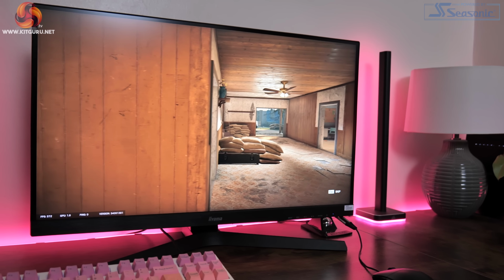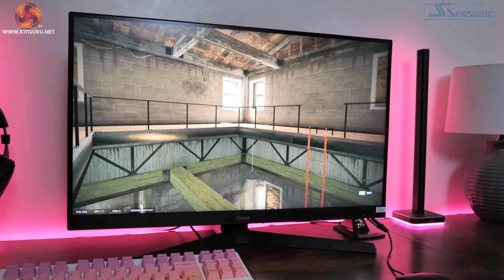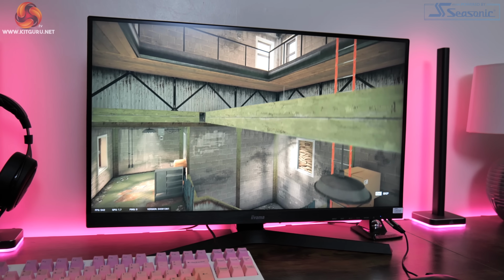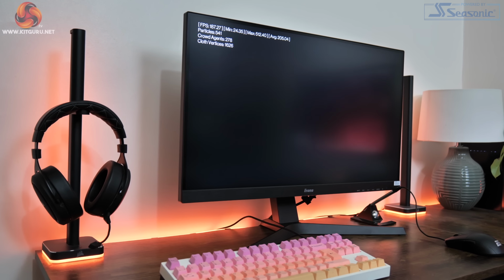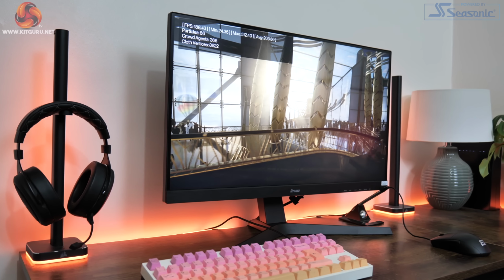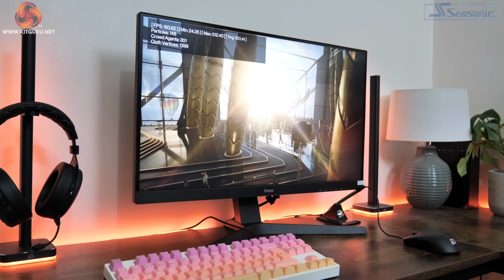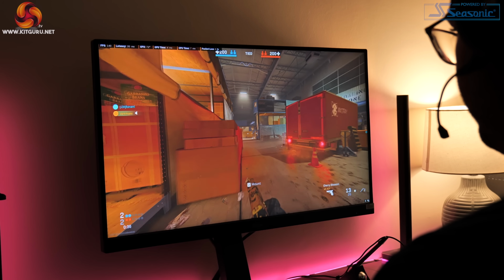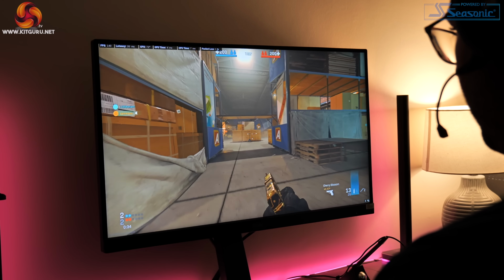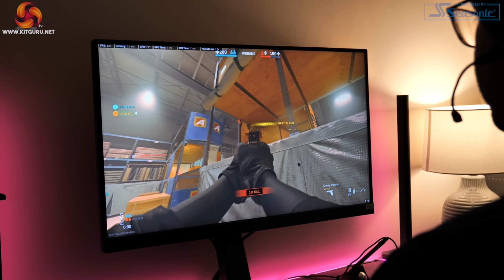In my experience, the third setting is actually the best, offering absolutely minimal ghosting without any visible overshoot either. Settings 4 and 5 do introduce much more visible overshoot though, while the ghosting is also more obvious on settings 1 or 2. On the third setting though, the default one, I had a great time flying about in Guardians of the Galaxy, and of course I whipped out a bit of Call of Duty, which was feeling very fast and fluid on this screen.